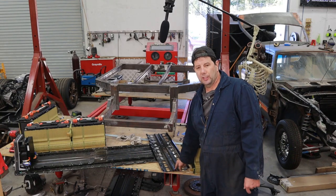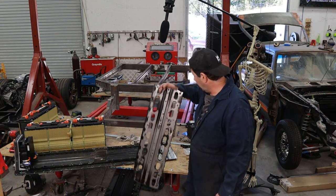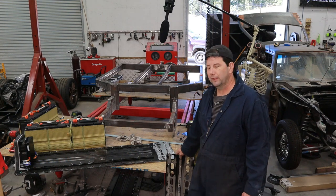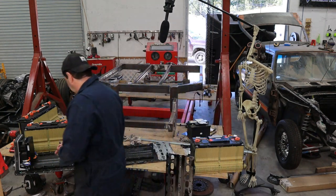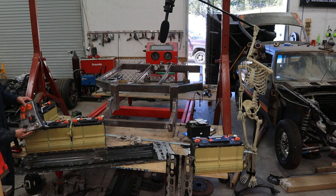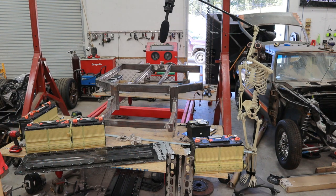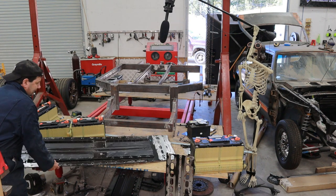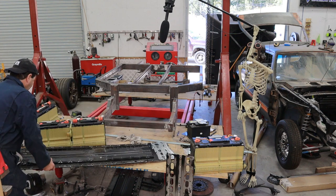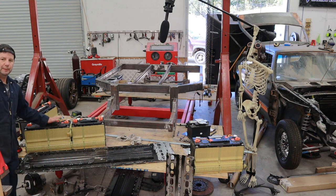This is the tray it originally came on. What I've done is drilled out the spot welds for the VAC T section so I can save that and use it on a different part of the build. This is actually the front compartment, which houses the battery heater as well as the BMS — the factory BMS. Now I've got this tray that I cut down to fit the entirety of the car, and what I've got to do is go ahead and put the batteries on there.